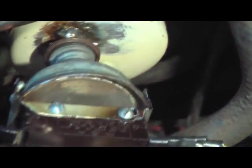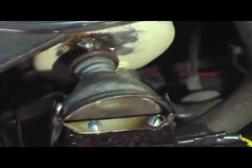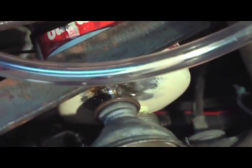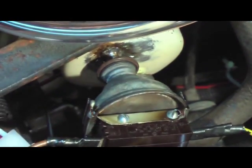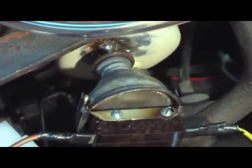I've got the micro switch, and there's a little improvement I'd like to make with that. I want to insert a spring on the inside of this oil can such that it increases the amount of vacuum it takes to open the switch. That way I should be able to get a little more braking force, since I know the pump can pump more than the switch is allowing it to currently.